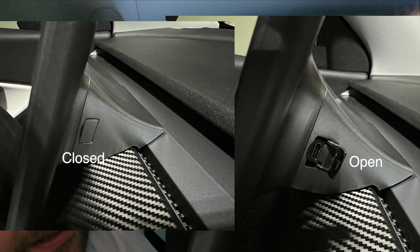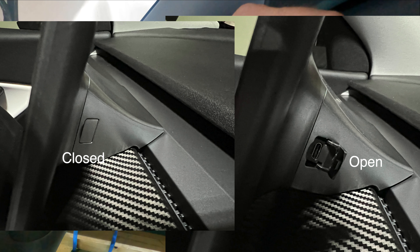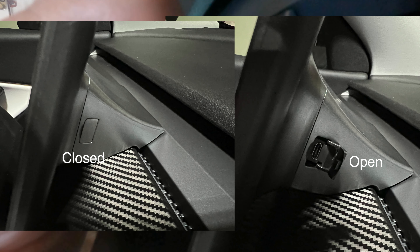I plugged that stick into a USB-A to USB-C adapter, because on the back side of the screen there's a little opening where you plug in the USB-C. The screen goes right to an update screen. You hit update, it runs through, it restarts, and then it says 'do you want to update the MPU?' You say yes, update that, it restarts, and just like that my screen works perfectly. I have no issues whatsoever — every time I get in the car now it connects to CarPlay and everything is good to go.